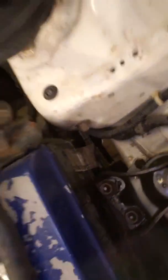That's the front driver's side motor mount — it's really really simple. Sorry I don't have a better video but I'm running out of battery. To recap: three bolts for the cruise control, three bolts for the motor mount to the frame, three bolts for the motor mount to the engine bracket, and two 10 millimeter bolts for the power steering line. Lift it up, move it out of the way, and just reverse those steps and you're good to go.